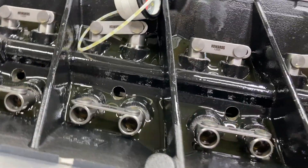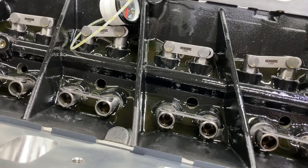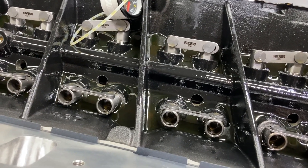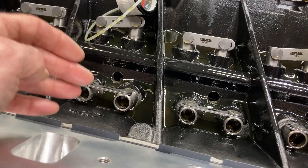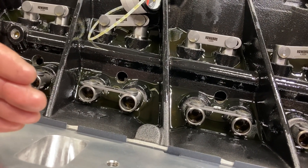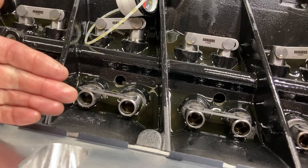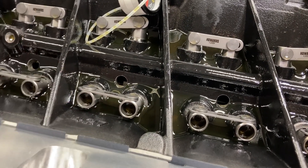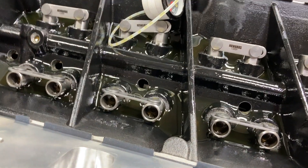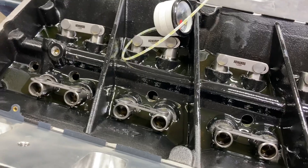I will do it once again when the push rods are mocked up with the rocker arms so that I can make sure all the lifter plungers are functioning. And then when I remove the rocker arms and the push rods, I want to make sure that these lifter plungers come all the way up to the top against the snap clip. Just some good tips and tricks to save you some hassle later on down the road.